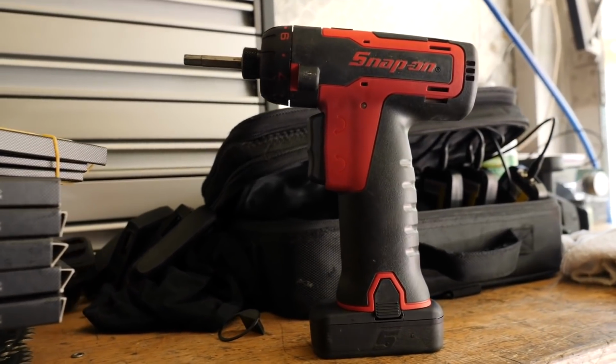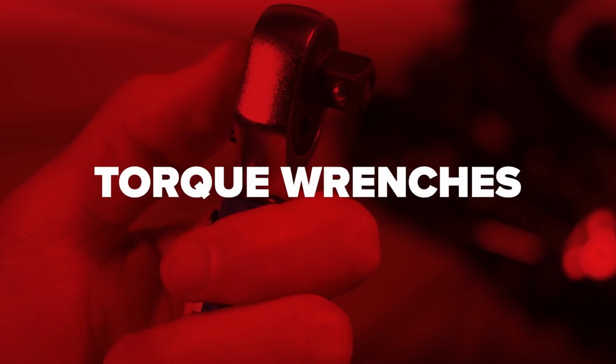But the big thing is here, if we were to use that, we would run the risk of cross-threading the through axle and damaging the through axle and our frame. We just quite simply don't need to use it. So stick to the usual methods and using an Allen or a hex key. And better yet, if you've got a rim brake bike, you won't even have to use that.